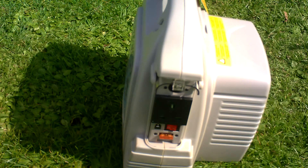For example, the fridge consumes 2.8 amps per hour. So obviously, because this piece of kit is a 40 amp hour, effectively I could continually run the fridge for about 13 to 14 hours — but then this battery will be dead. So what I tend to do is just charge up the fridge one to two hours every day, in the mid-afternoon and then early evening, and it does keep the food nice and cool.